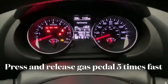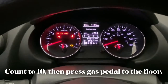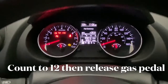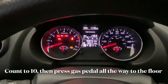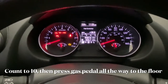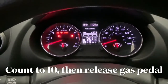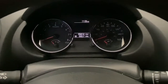Now perform the pedal sequence: count to 3, press the gas pedal 5 times hard and fast, count to 10, press it to the floor, count to 12, release it, count to 10, press to the floor, count to 10, and release. The sequence involves pressing and releasing the accelerator in a specific timed pattern — counting in increments up to 12 and then back through several sets. Let off, then shut off the ignition switch. Give it just a second and this thing should be shut off.